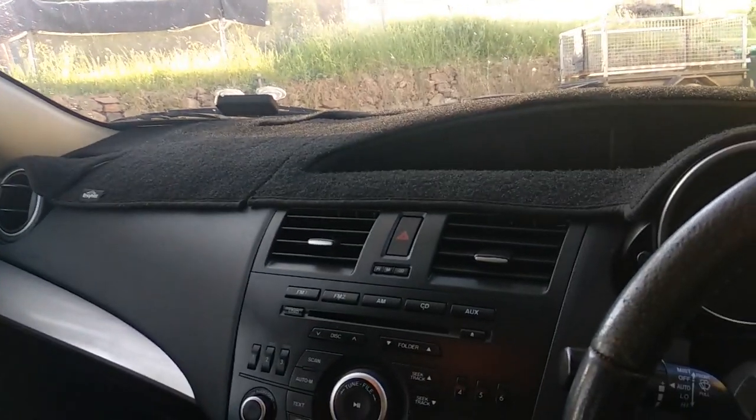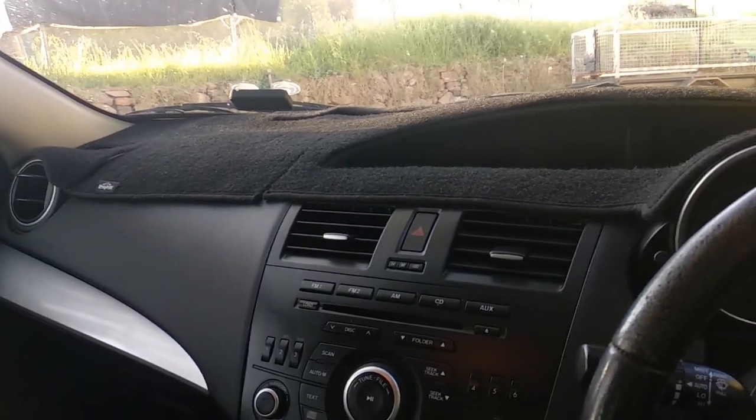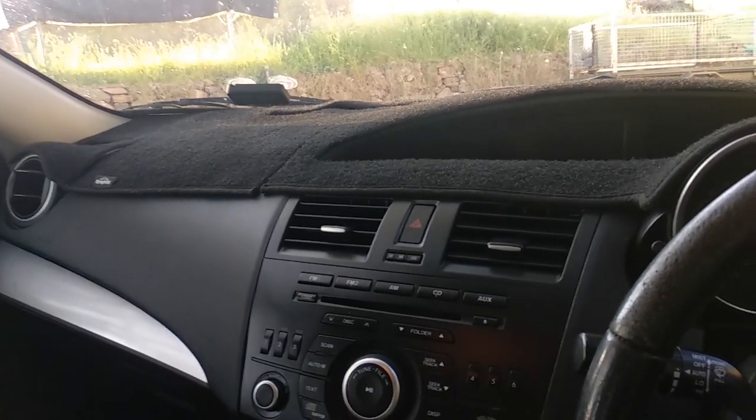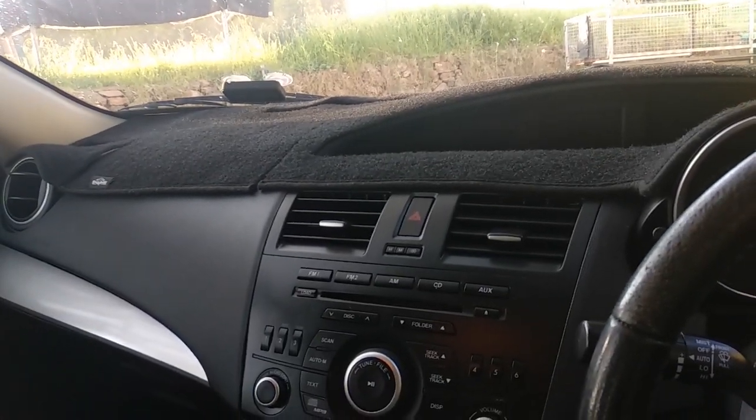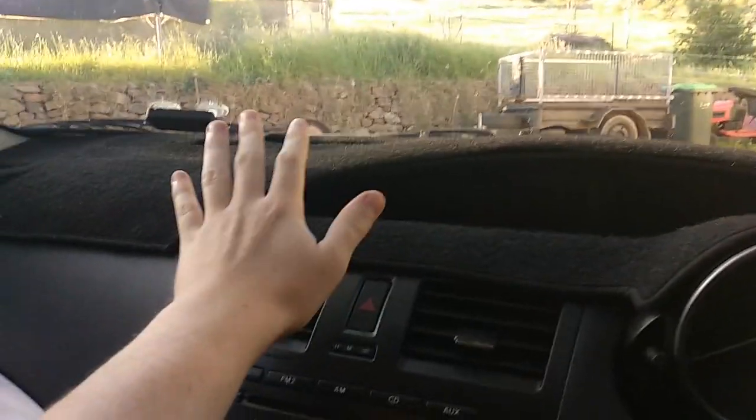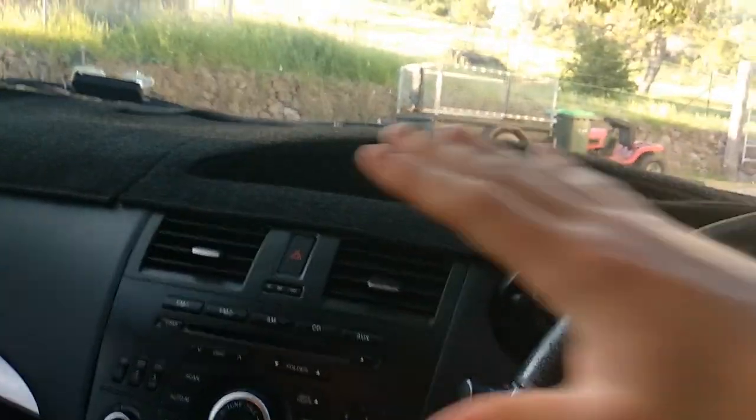They'd find a song with pretty heavy bass that sounds quite loud and give it a run and see how it goes. The second test is I'm going to run some sweeps to find where the car peaks. I'm going to remove this carpet, put the seats down, take the cover off where the sub fits into the spare tire, and have the car as open and as optimized for SPL as possible. I'm also going to leave this door open as it should do some kind of cross loading and be a bit louder.